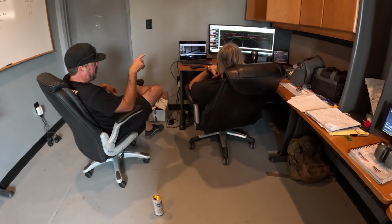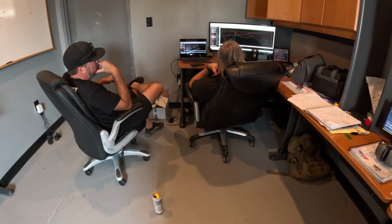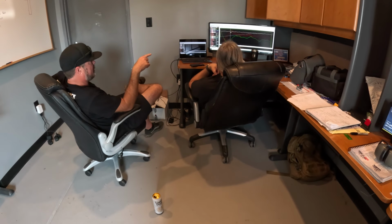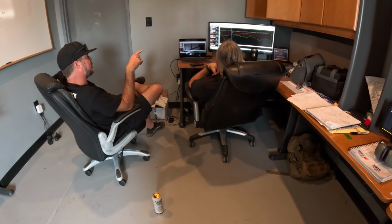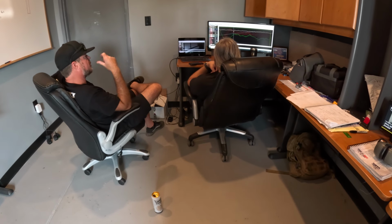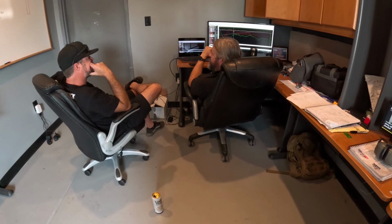If you look up the oil line. Is one happening before the other? It's making the boost, which makes it slip. Well, if it's slipping, the engine RPM would go up, which is what it's doing, but the boost is going down. Sometimes they'll do that because they'll kind of swallow the boost a little bit.